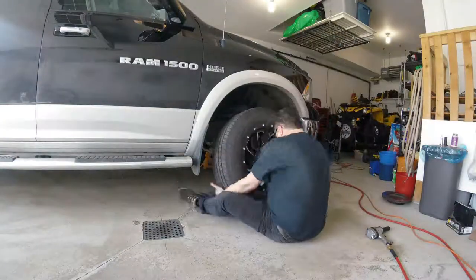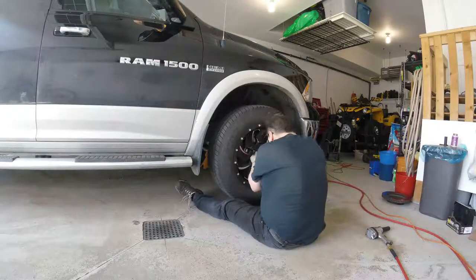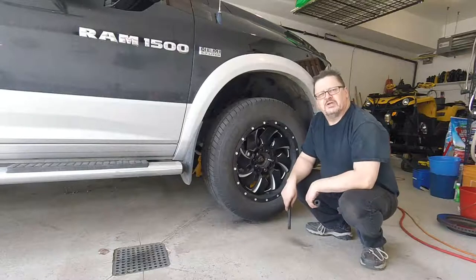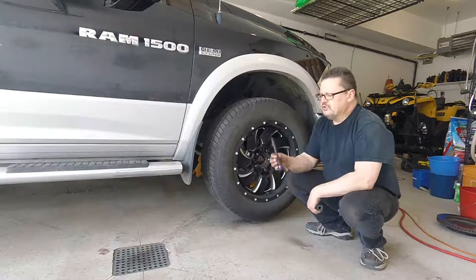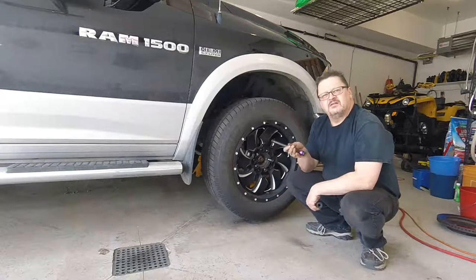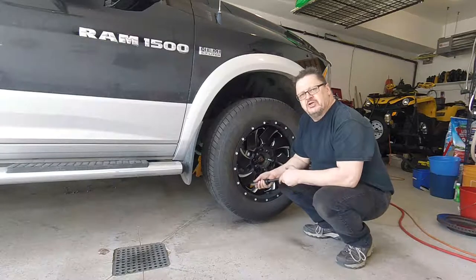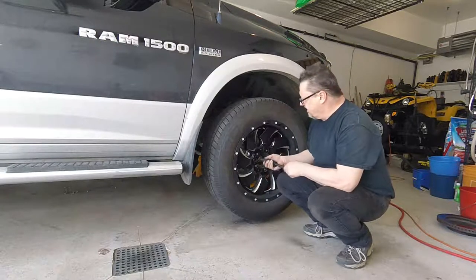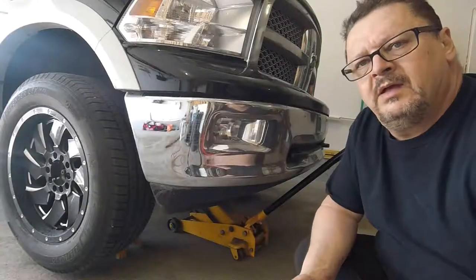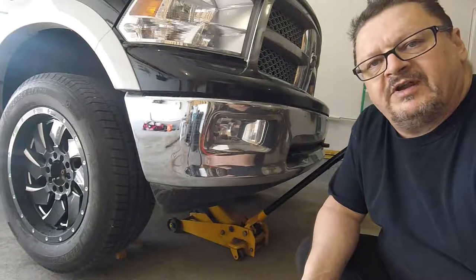We're going to put the wheels back on and we've got to do a test run on the brakes. There is a set-up process which I'll go through in a moment once I've got the wheels back on. The torque specifications for the wheels are around 130 foot-pounds. I'm going to use a torque rod to accomplish that while it's lifted, and then once it's on the ground I'll probably check it again with a torque wrench just to validate that everything is in sync. You want to make sure you tighten them in a crisscross pattern to get even pressure around the whole hub of the wheel. Now let's get it back on the ground and take it for a test drive and break in those brakes.